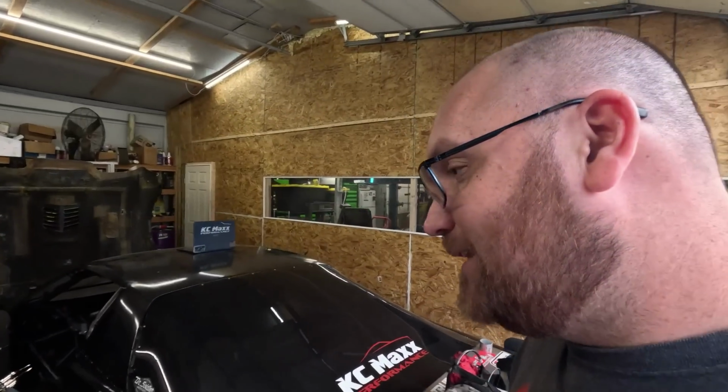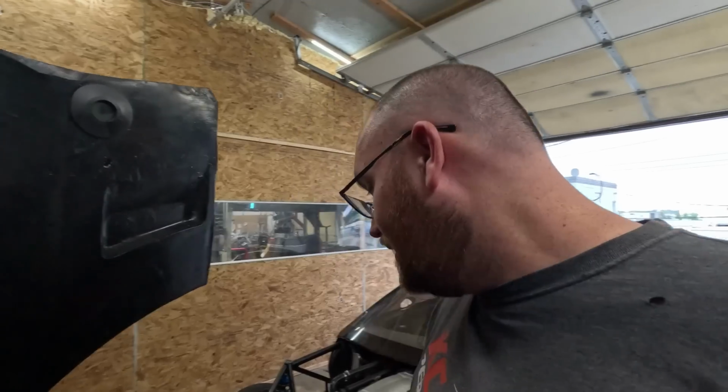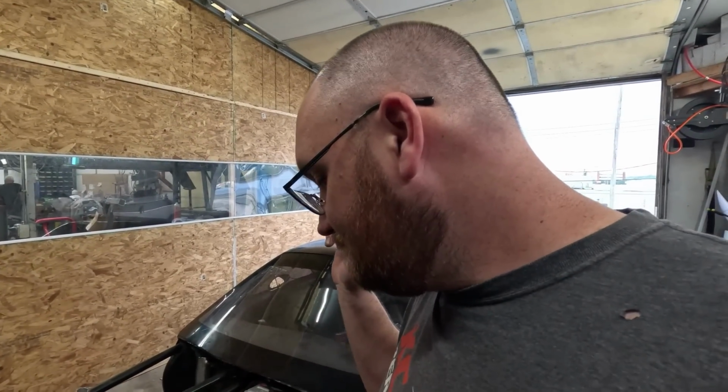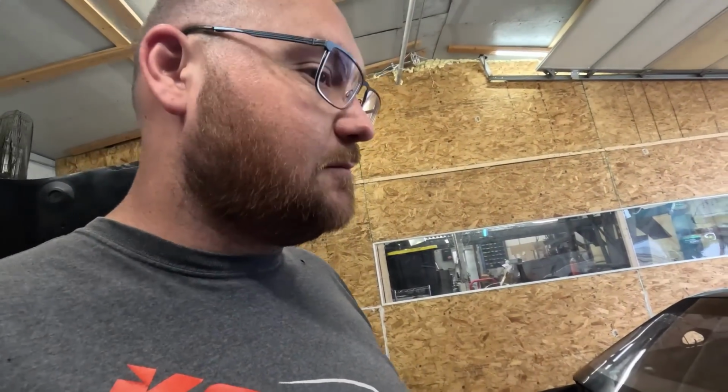So, we got the spring set to about 52 thou from coil bind, which is a lot closer to the industry standard than 180 thou. So, anyways, let's make a rip. Let's make a rip. See if this thing does something cool.